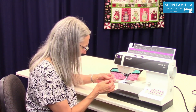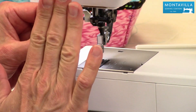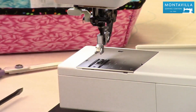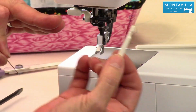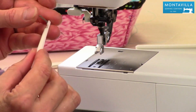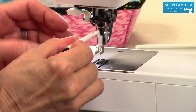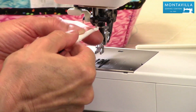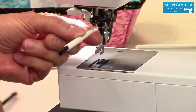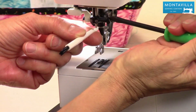Your needles all have a flat side — you want to make sure that flat side is facing away from you. You can put this in using your fingers, but I like to use this little tool — it's a brush with a needle inserter at the end that acts like a handle for the needles. Put that in there making sure the flat side's away from you, poke the pointy end right down where it sews and bring it straight up in the center. Push it all the way up to the stopper, tighten it a little bit by hand, then tighten it a little more with your screwdriver just so it's snug.